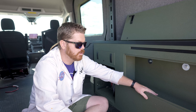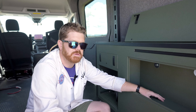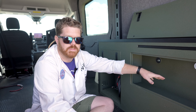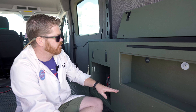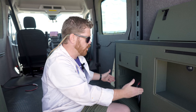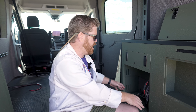On the power side of our cabinet over here, we designed this so it'll fit a standard group 31 battery — so that's gonna be like your normal AGM battery or your Battle Born lithium-ion battery; those are all gonna fit nicely in this section here. We also have an option where you can cut down the complete shelf and have a larger, more vertical opening so you can fit different pieces of a power system. For us, we put in our Yeti Goal Zero 3000X, and all the pieces and parts to make that system completely integrated are included in the kit.